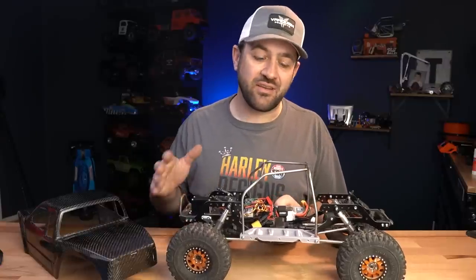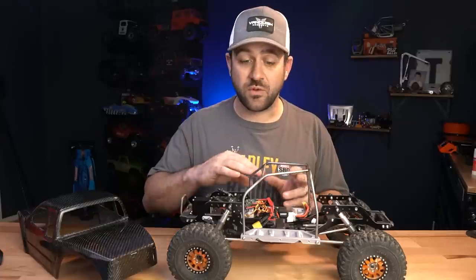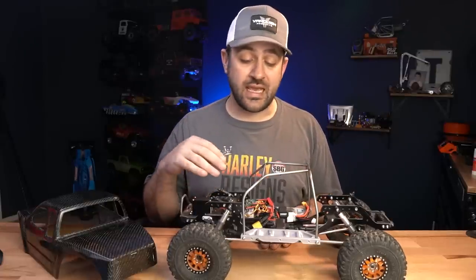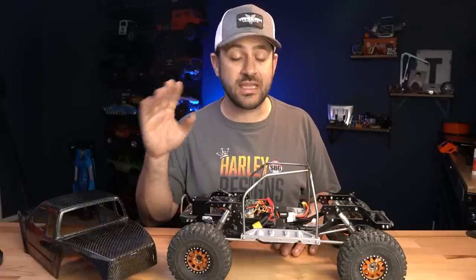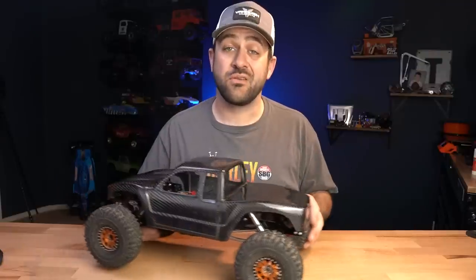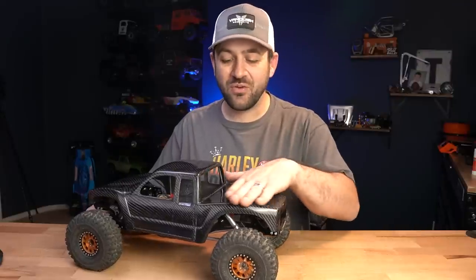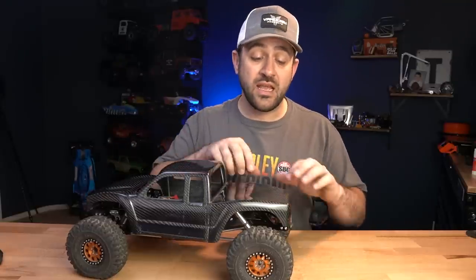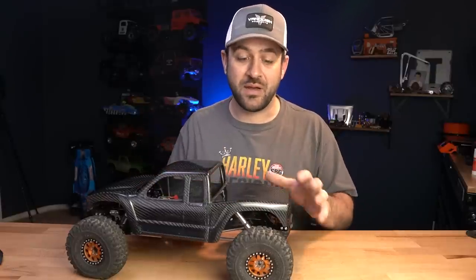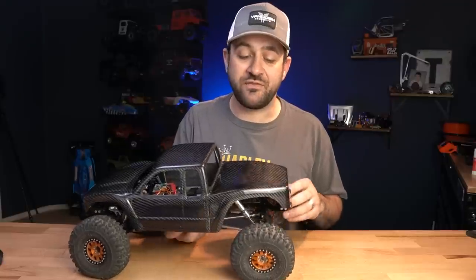I have started the design of the interior, but I haven't gotten all that far. It's going to be much more basic — I'll put tabs onto the cage and have a very flat floor that the seats all mount to. The dash will be separate, likely vacuum formed, and I'll keep it minimal and lightweight. I'm going to get the points and move on to the best of my ability. As for the rear of the body, I'm still contemplating cutting the rear out for like a drop bed. It looks pretty good with the back covered, but it's not my favorite. If I leave it like this, I may come up with a simple roll bar or something made out of that eighth-inch titanium rod, mounted to some plates to sandwich and mount the body onto the chassis rigidly. A main hoop and two tiebacks would look good — but I'm open to suggestions.